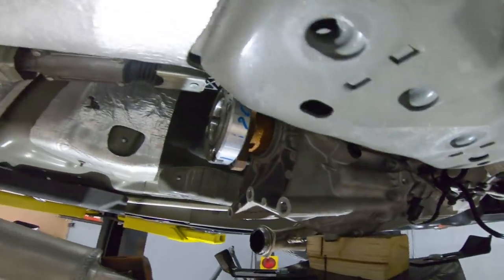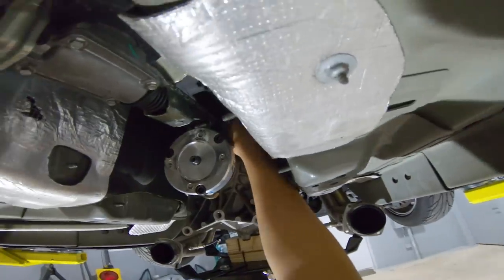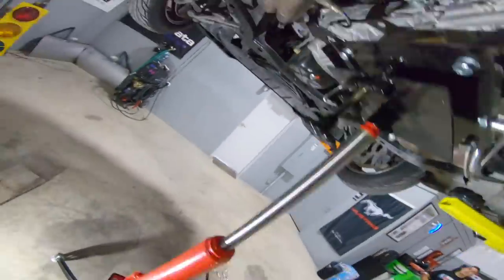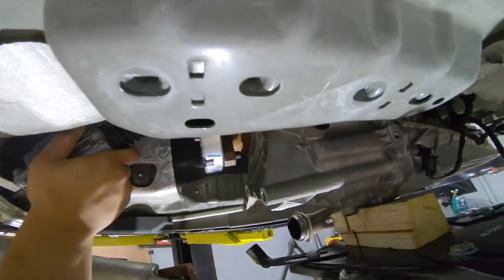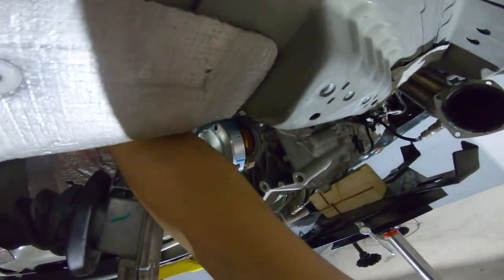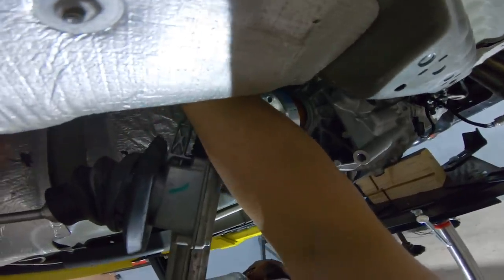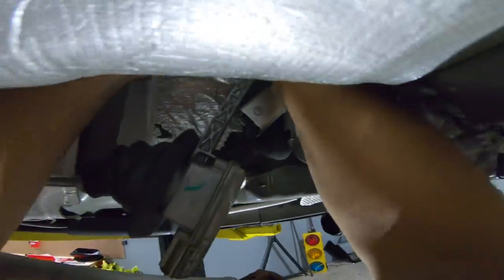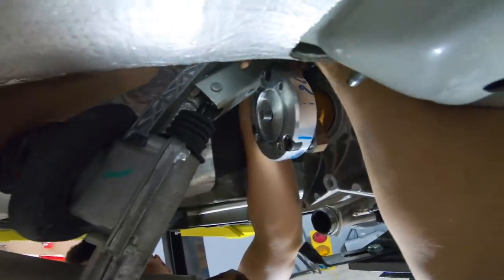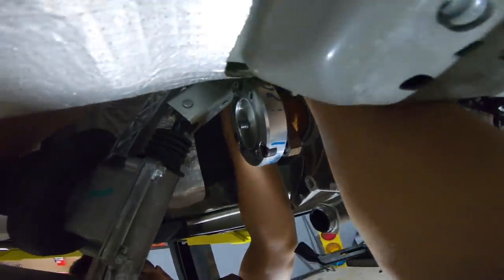Hell yeah. And now there's just one bolt up there holding it, right? Let me feel. 'Tis a 10. There's no backup nut, so we just need one 10 millimeter wrench. Oh, there's one more bolt. Oh, I don't like whenever this happens because I know it's coming. My hand's about to get pinched somewhere. Oh, come on. It's so hard to tell what we're even doing up here, but there's just one more bolt on top of the output shaft of the transmission. You really couldn't even see it if I wanted to show you where it's at.